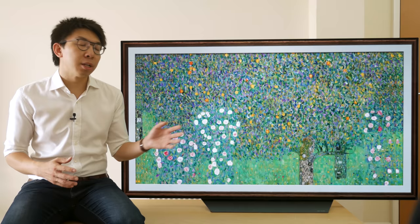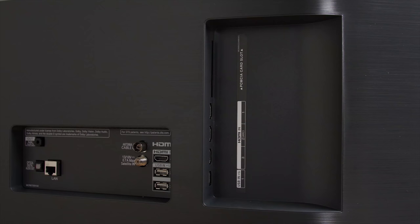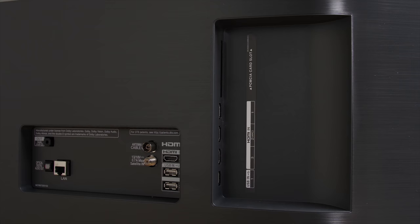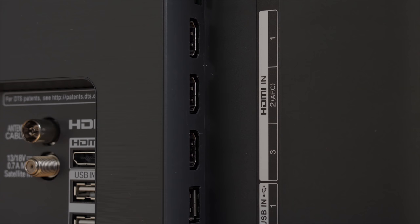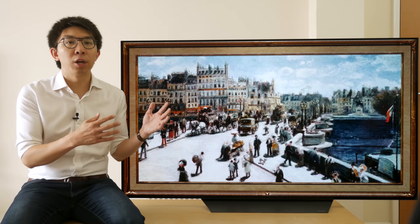Even the design is almost identical to 2017's LG C7, with a slim black bezel and a central sloped stand bearing an LG OLED inscription — just so you can be absolutely 100% sure that you bought an OLED, not a QLED. The connections are located at the left rear of the display, including 4 HDMI inputs, all of which are full-fat HDMI 2.0b ports with HDCP 2.2 compliance, so you can plug your Xbox One X, PS4 Pro, Apple TV 4K box and 4K Blu-ray player to any of these 4 HDMI connections and enjoy 4K HDR content at higher frame rate, chroma or bit depth without any issues.